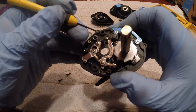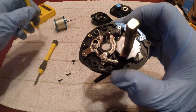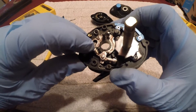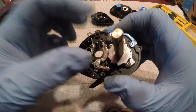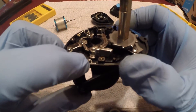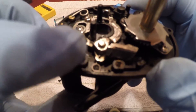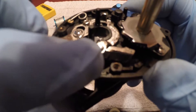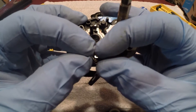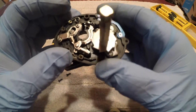I was concerned about launching this spring behind my washing machine and the whole thing going in the trash. So what I did is I took this one all the way off and I loosened this one a lot, but I didn't take it all the way off because I didn't want it to spring out. Once you can get this to lift up a little bit, you can pop this little spring out of the back because it comes in from the back side. That has to be lifted up a little bit so you can pop it off the bottom. Once you do that, all you really need to do is just grab that spring and open it up a little bit more so it has a little bit more tension on it.